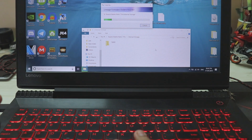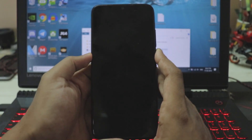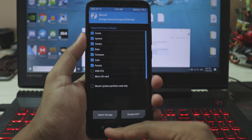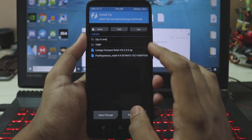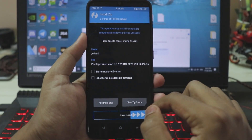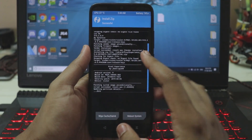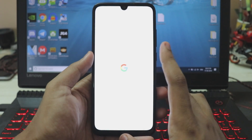Go back and browse to your PC — the Redmi Note 7 Pro internal storage will appear completely blank. Copy over the LineageOS firmware, GCam, and the Pixel Experience ROM. Once everything is copied, go back to your phone, swipe to unlock, go to Mount and mount everything — system, vendor, everything mountable — then go to Install, select LineageOS firmware, add the Pixel Experience ZIP, and confirm to flash. It will patch the vendor and install the Pixel 3 ROM automatically.